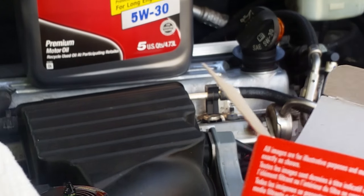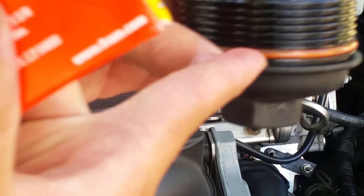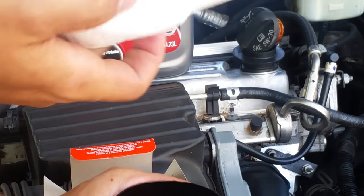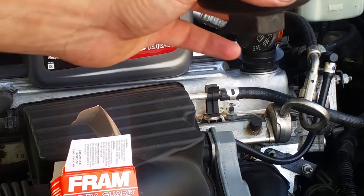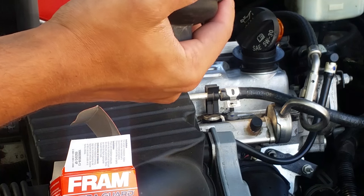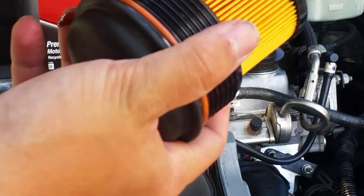The filter comes with a new o-ring for the top of the threaded canister. I'm going to take a paper towel and pull the old one off, then grab the new one. Hold it by the little stub at the bottom because that needs to be poking up when installed. Just push it on like that, and then you'll need a screwdriver to seat it.